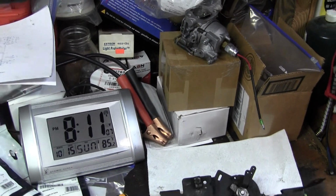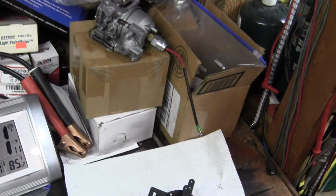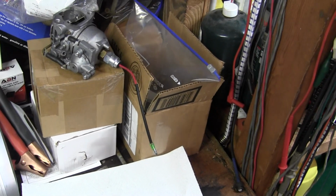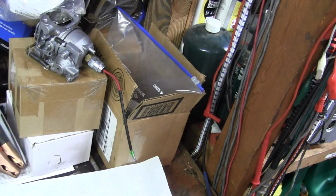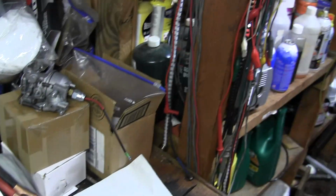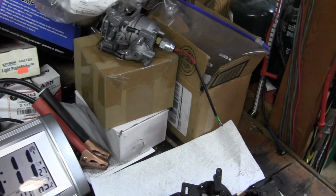So that caused the number one failure of these Kohler Command engines, the quick change oil feature. If you've got that valve on there, take it off the engine and block it off. Get a plug or a better way. And I'm not going to tell you the engineering on a better way because I don't remember the part number. I don't have any notes on that.